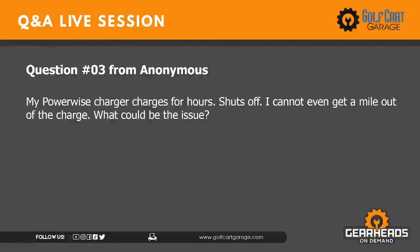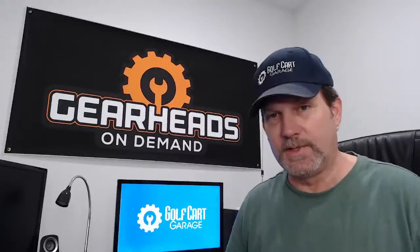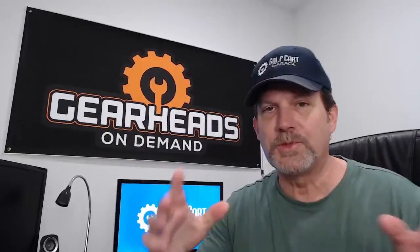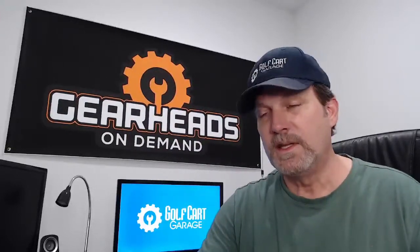Three. A PowerWise charger charges for hours, shuts off. I cannot even get a mile out of the charge. What could be the issue? Well, my question would involve battery voltages first. I'd love to see the battery voltage upon failure. In other words, when you say you cannot even get a mile, I'd like to see what your battery voltage is right there and make sure that's where the problem's coming up, because you got to understand, thermal shutdown in a controller feels exactly like your batteries are going dead. So how do you know it's your batteries?